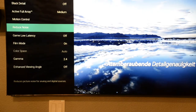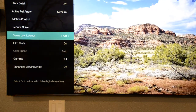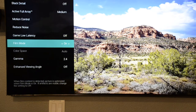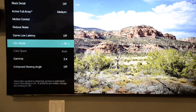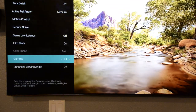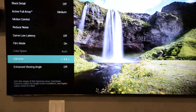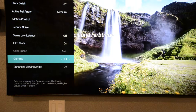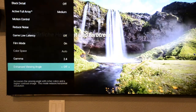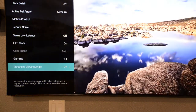There's Analog Noise and Digital Noise — leave both off, though you can put it on Low if you prefer. Game Latency leave it off since this is for video content. Film Mode leave it on because it is for video and movie content. Color Space set to Auto, so you don't have to worry about it. Gamma set to 2.4 — even though it's hard to hit exactly, it usually stays around 2.2 or 2.3. Viewing Angle leave it off; turning it on adds a sub-pixel cross that affects side viewing, so stay centered in front of the TV.